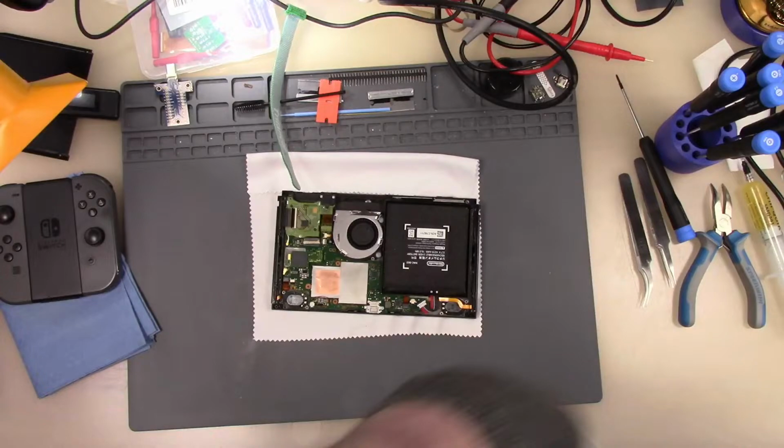We are gonna add some thermal grease to it. I use MX4 here. So we will put a little smattering of MX4 on here. Just about that much, way too much, because I never put the perfect amount. So we'll get our heat sink that we previously cleaned. So that will go down there like so, and we will get our screws. There we go.